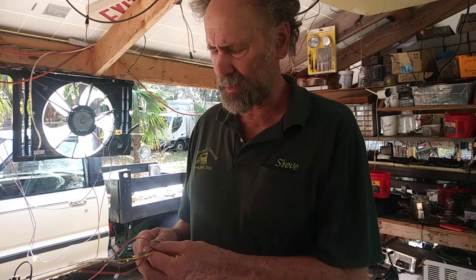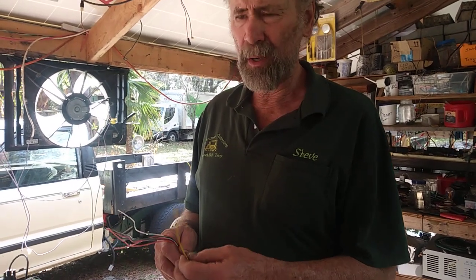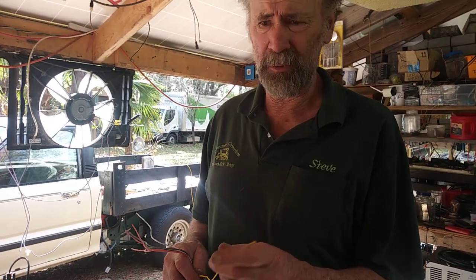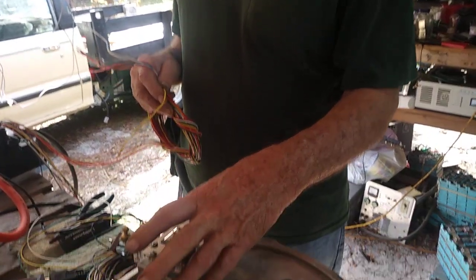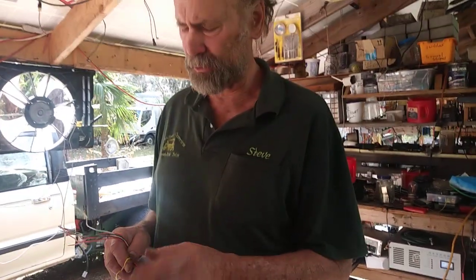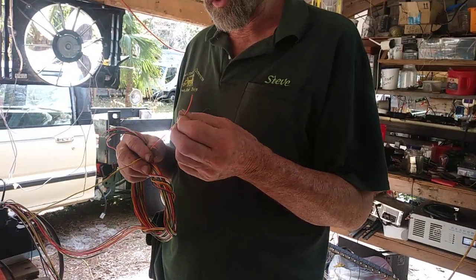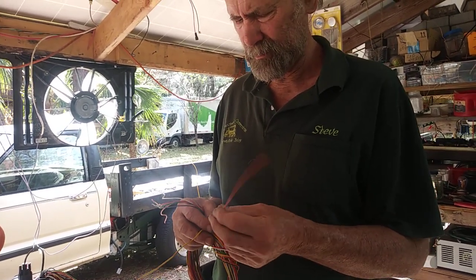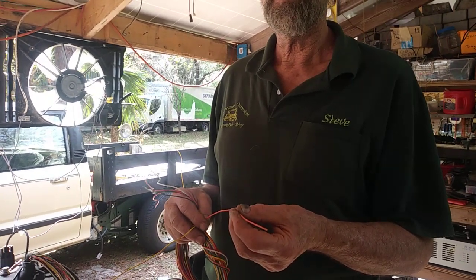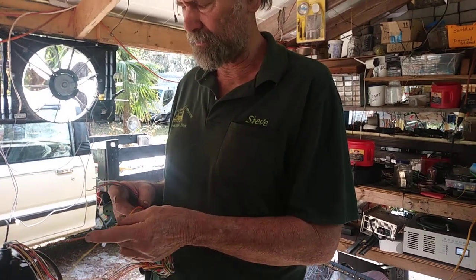Here are all the wires that we are not using. First one is the yellow with a red wire, which is the brake pot wiper — this means you have something that measures brake pressure and it adjusts the regenerative braking to that brake pressure. You either have it like a throttle on your brake pedal or some kind of transducer which changes resistance. We're not doing that. Next is the totally orange wire, which is a 12-volt output. Then we have CAN H — that's a CAN output giving CAN information going out.